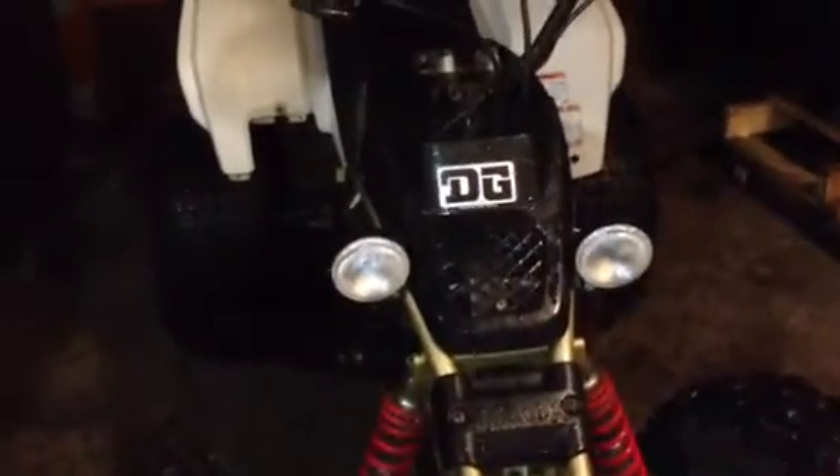Looks like I got the KX sold as is, so that's that. I picked this blaster up a couple weeks ago and it's just been sitting next to the other blaster. After I got that blaster done I was going to do the Predator, but then I realized since the Predator's going to take me 3 weeks — because I'm going to build it in increments, it's a 4-stroke, I'm not going to rush it — let me get the blaster out of the way since it'll be quicker. So I brought in the blaster. It's got a blown motor, bought it with a blown motor. It's already been torn down and redone to the frame by the previous owner — he did a fantastic job. Brand new turf tamers in the back, nice wheels in the front. Basically he was driving it on ice, let his friend drive it, he didn't come out of second gear, going back and forth on the ice and locked it up. Now it's kicking back. I've had that same problem before and it blew the crank, top end, cylinder, and everything. So I'm pretty sure I've got to split the cases, but it's got a full DG setup, shocks are really nice, back plastics are mint, recovered seat, front brakes are brand new, new grips, nice headlights. I figured I'd do the whole motor build on this one and get it done so I could sell it faster.